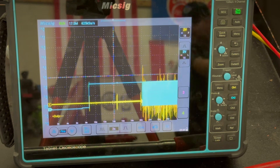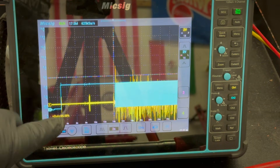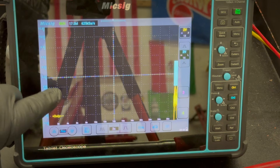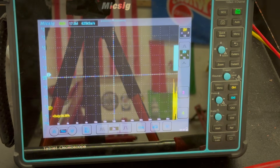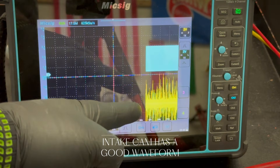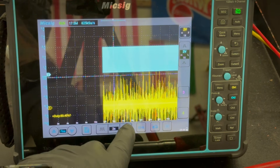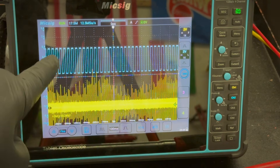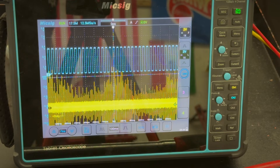I am working solo, so I had to use a pedal depressor. As we can see, my blue one has a trace. I'm going to raise this up so we're able to see both waveforms on their own to make sure we're getting a signal on each. If you notice, my intake cam has a good waveform. My exhaust cam looks to be completely dead, so we're going to have to do some checking there. We can reduce the time and notice how we have a square wave for the intake side but the exhaust side isn't giving me a waveform whatsoever.